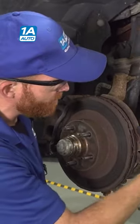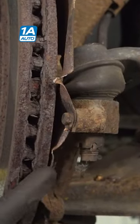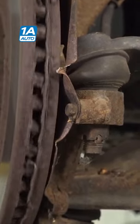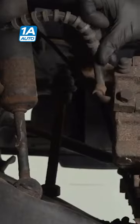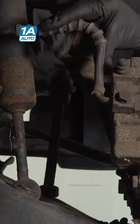For me in particular, it sounds like it's coming from the backing plate. I can see that this is pretty much pressing right up against the rotor right there. Let's have a look at the flex hose real quick because it leads to the caliper — we want to make sure it doesn't look like it's restricted in any way.